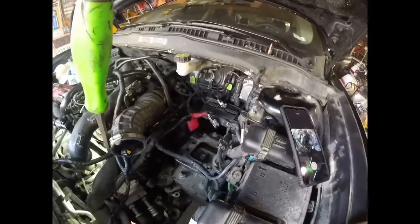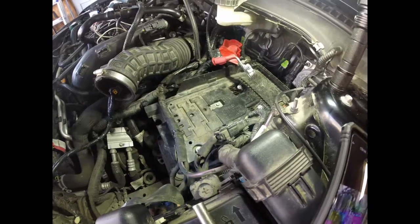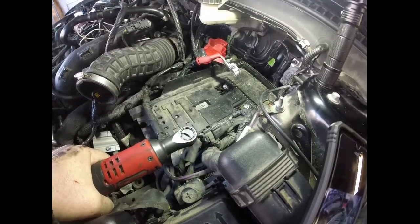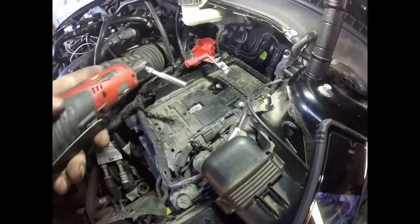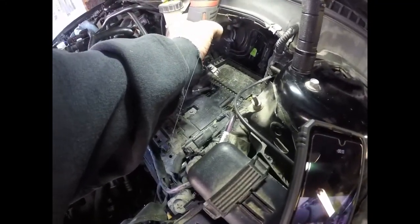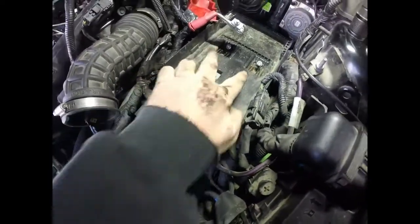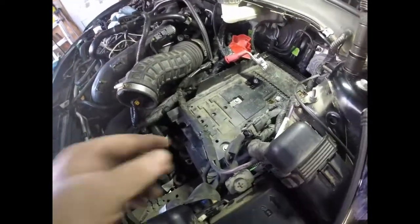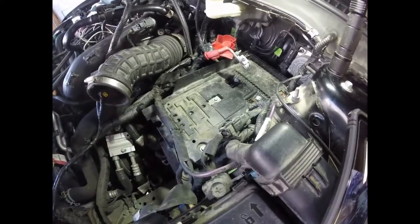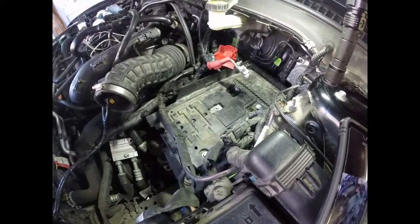We will go ahead and put the battery tray back in and the air box, then I will show you what's going on underneath. Once you get the battery tray lined up, you have got four bolts — they are all 8mm. You have got one here, one there, and two in the back. Then you have got a couple of different clips — use a cat claw and unclip some of the harness that's hooked to it. It's not too hard, just get a cat claw and unhook them. Then get an extension, tighten those up, and start putting the battery back in.